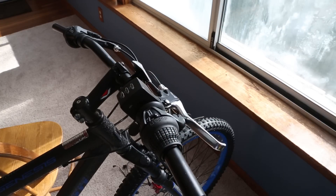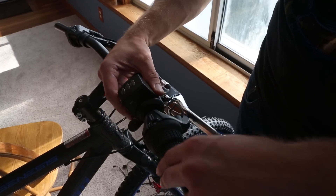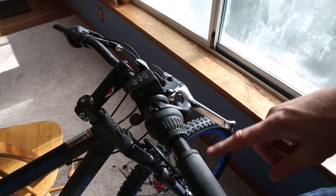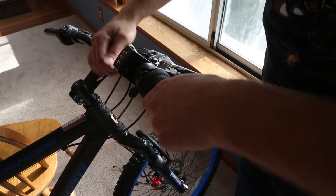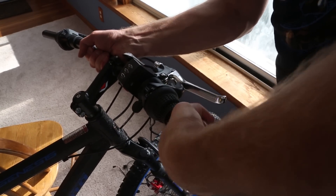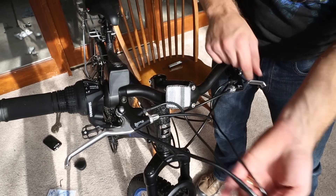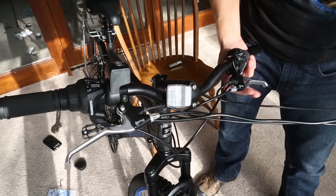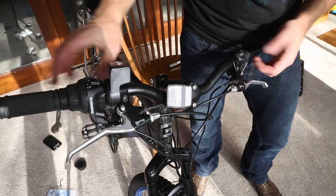My original handlebar is a little longer than this, so I should be able to shift all this down just a little bit so it all fits on there correctly. These are always hard to get on. One little trick is to stick an air compressor in this little hole right here, blow into it, and then it'll push on real easy — I did it to get it off and it worked surprisingly well. But pushing on is a little easier than pulling off, so I think I can just work this on. You'll have these three lines: your acceleration, right brake, left brake. You're going to have to take these and figure out a way to tuck them back to get to your controller unit. It went on surprisingly easy, so now I've just got to use my Allen wrench and tighten this all up.